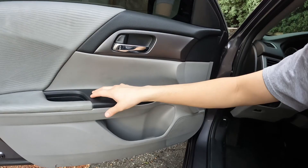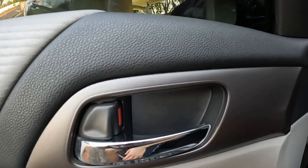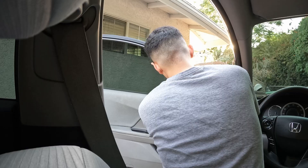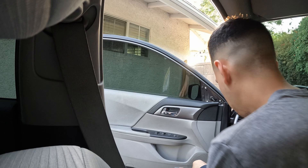The main components to taking off the door panel are this pillar, a control panel, and a little insert point. You can take this off and it'll have some screws behind there — screws behind here — and that's so you can lift the door up and take it out. Just pull it; it has this green tab, put it into the hole and pull it so it pops off.